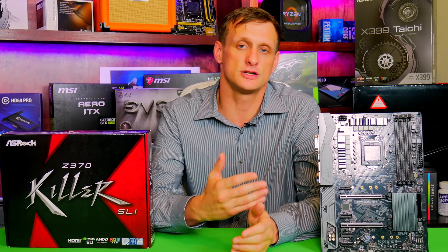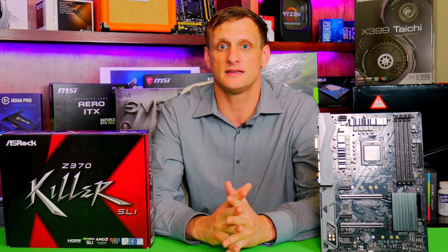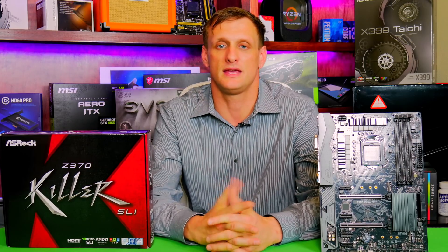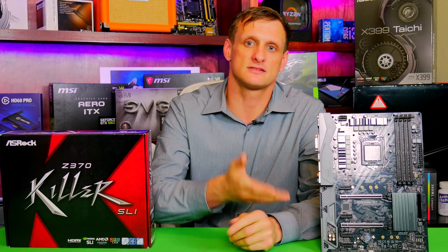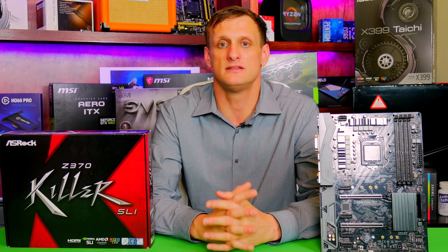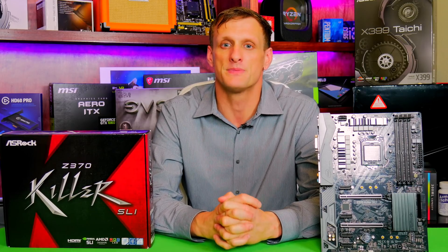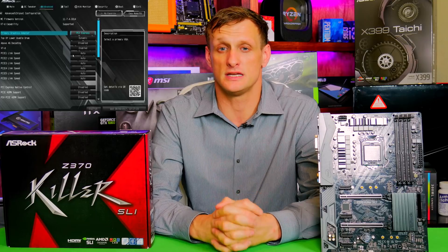While there isn't currently a Pentium available for these motherboards, later on down the line this could drop in price, and when Pentium versions of the 8th gen Intel CPUs come out, we could have a decent mining motherboard right out of the box. It's been kind of hard to get a hold of mining motherboards thanks to miners buying them up. This could be an option for a 6-GPU mining setup or mining rig. In the BIOS, I was able to find that it does support above 4G decoding, which is right up the alley with any sort of mining motherboard features you want included.